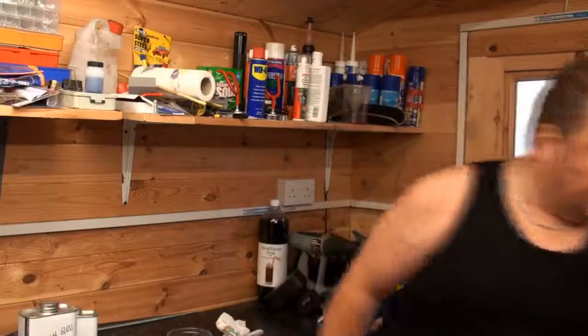If you've got a spray gun which you use for solvent based paints, you may find that it applies the paint differently than a water based paint gun. The setup I've got, as I said, is 2 DeVilbiss SRI spray guns. One has a 0.8 needle for the base coat application, and then I've got the same gun with a 1.0 needle in it for the clear coat application. Those are my touch-up guns. They're not guns for spraying a whole car with, they're what they call spot repair guns. That's why it's got a small cap on it, if I show you.